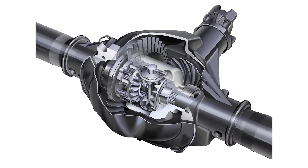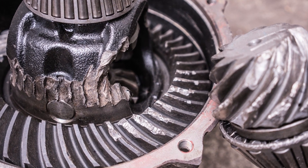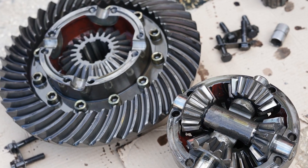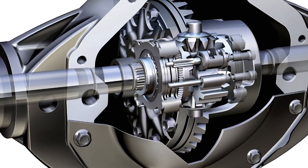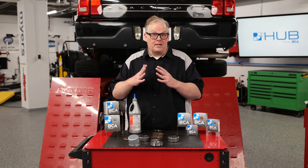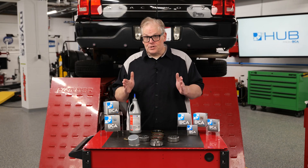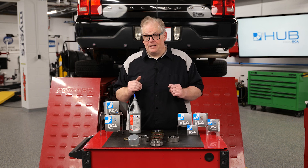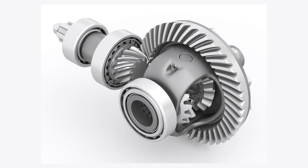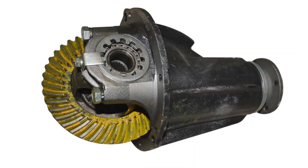Inspecting some differentials can be challenging. The first item to check is the ring and pinion gears — any unusual wear to the teeth can indicate misalignment or a failed carrier bearing or pinion bearings. Look at the spider gears inside the differential; they should rotate freely, and if the vehicle has a limited slip differential, look up the inspection and service procedures. The most challenging part of the repair is setting up how the ring and pinion gears mesh. The pinion gear typically has two bearings between the yoke and the gear, and the bearings and crush sleeve work together to set the height and preload. Carrier bearings may have shims or adjusters to move the ring gear laterally to align it properly with the pinion.